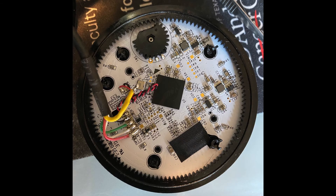Here's a clear picture of the back of the circuit board. You can see that outer ring — it's a gear that turns the potentiometer at about the top of the picture. That potentiometer was also busted, and all the plastic posts that hold the webcam together were sheared apart. If you turn the potentiometer too far into its current position, it will disengage from that outer ring. I just turned it by hand once I fixed it and left the brightness all the way up.